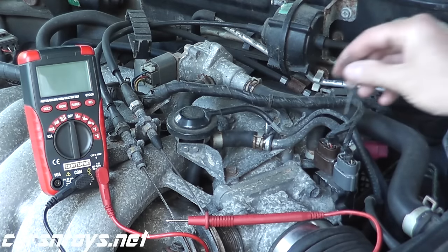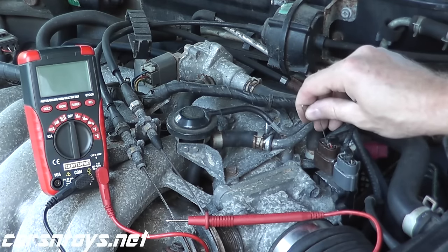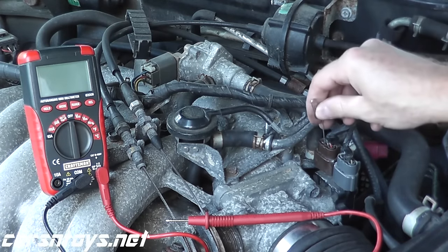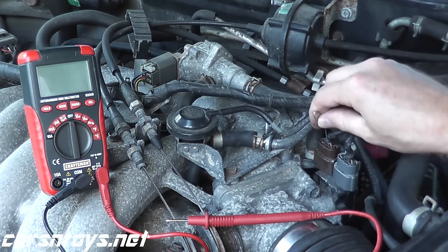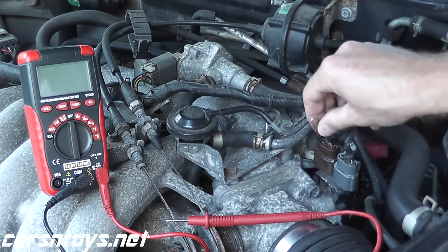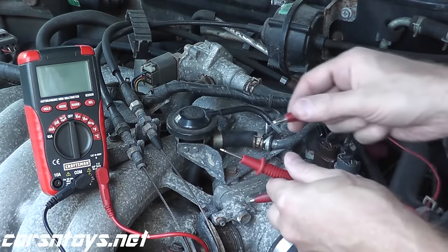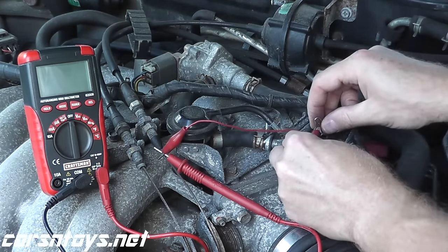Taking a look at the harness connector, you have three wires going into this specific harness, and we need to access the middle wire. I can't disconnect the sensor — I need to keep it plugged in to get an accurate reading. To bypass the little grommet built into the harness connector, I'm using a paper clip. Just press down until it stops and then you have a clear metal-to-metal connection. Then with the multimeter, the red lead touches the paper clip — I'm just using alligator clips here to make the connection.